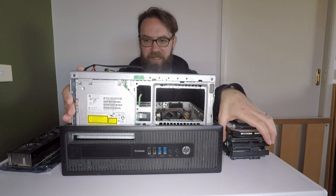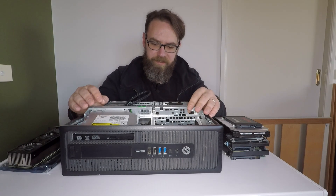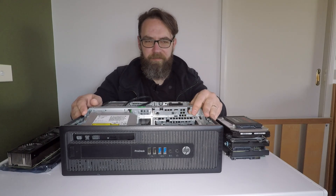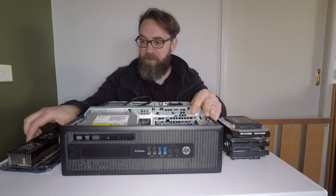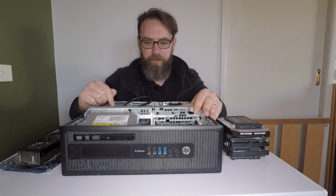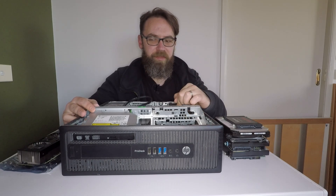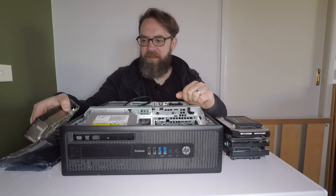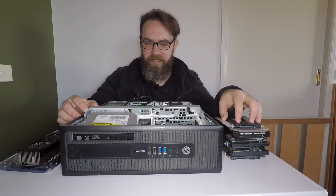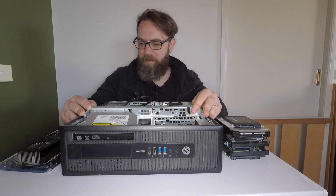Given that we're going to try and squeeze three hard drives in here plus the SSD, we're going to have to do a bit of modification to the case. The reason I went with this over the Dell was the motherboard actually has four SATA ports on the HP — the Dell only has three. I'm going to be using this for media storage or a media server generally, but also for video editing, hence the video card. The power supply is rated at 240 watts so we'll definitely be pushing its limits — it's got an Intel i5-4670 CPU rated at a maximum of 84 watts, the video card is 75 watts, and the hard drives average about 9 watts each, so we're looking at very close to 200 watts, probably a little bit over that.